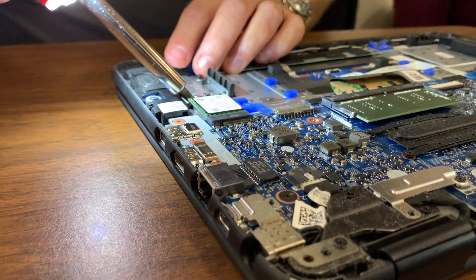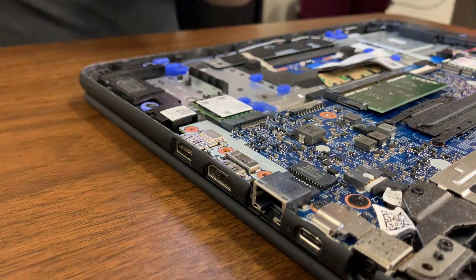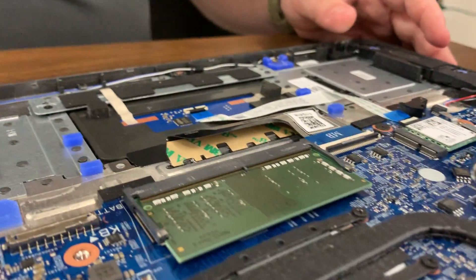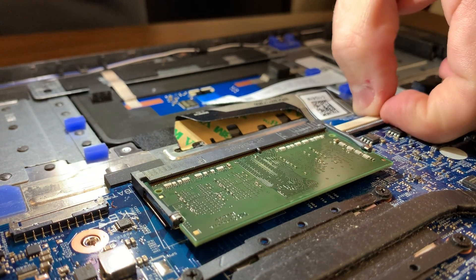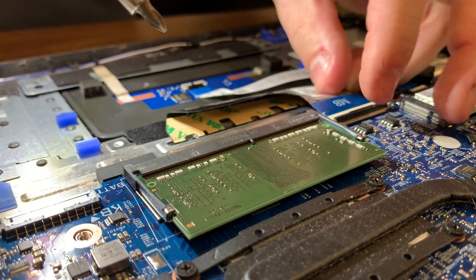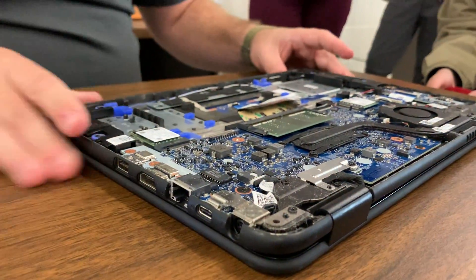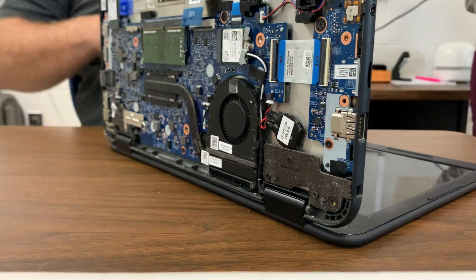You went over SSDs — talking about how you have to insert at an angle. Once we're done, we're going to lift up the backside of this piece — this holds the ribbon in and locks it down. Once we lift that up, it lets the ribbon go and we can slide the ribbon out. There's a blue tab on each ribbon that you can grab and pull on.